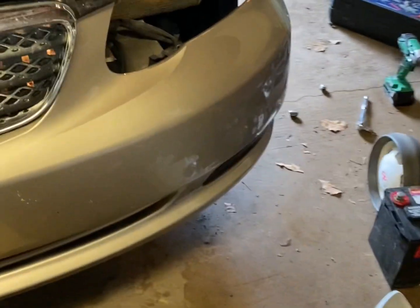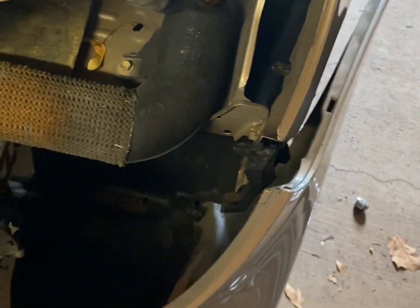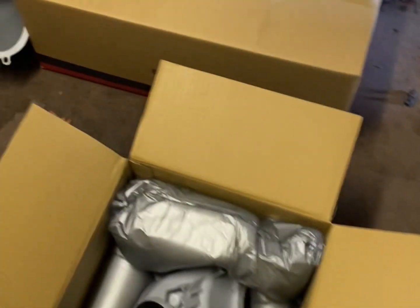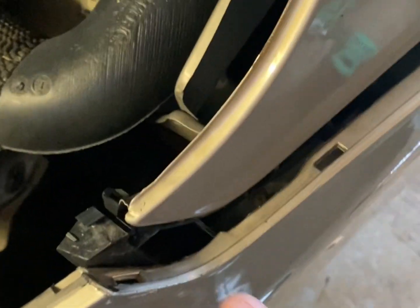Alright, one is out — and I was incorrect, you do not have to take the entire bumper off. The bumper is a bit pliable. What I did was take the front grill out, which just pops right out. After you take the retention bolts out, the whole front section moves and the headlight assembly is held in by a bolt up top and another clip that you can only reach if you bend the bumper back and approach from an angle, because it's screwed in sideways. It's a bit of a pain, but it's out.